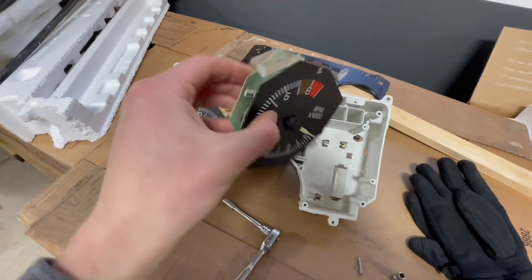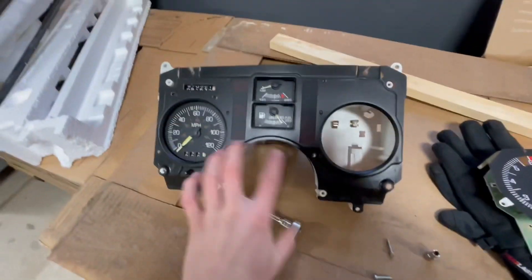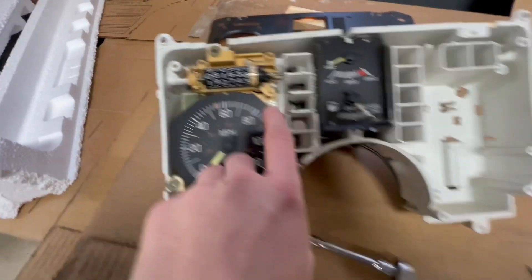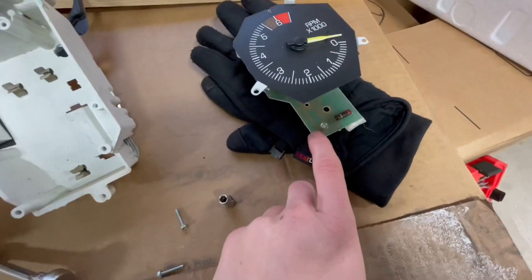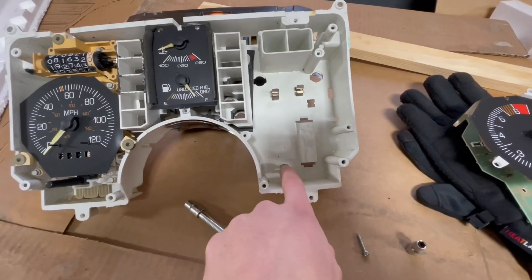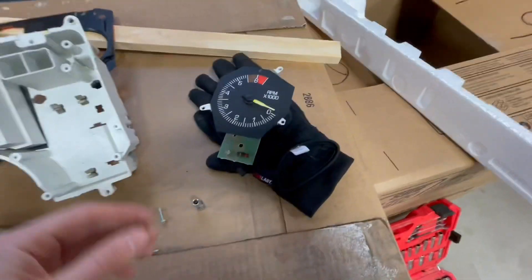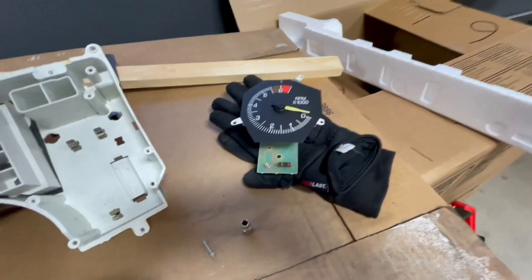Well, that wasn't too bad. After you take the cover off, there are a couple screws that hold it on. Then behind there, what holds the actual gauge and board are these little screws — 7/32nds, there are only two but I think there's a third. Then there's one that's a quarter inch right here which doesn't come all the way out — I think that's probably for a ground or power. It's not in awful shape, so I think I can just throw it in the car. Maybe I can look at it and see if there's any noticeable differences — maybe a resistor or component is burnt out. I honestly have no idea, so I'm just going to try throwing this in and see if it does anything.